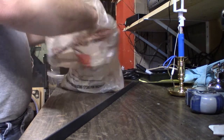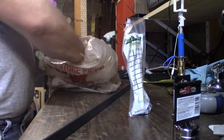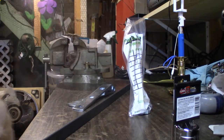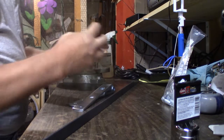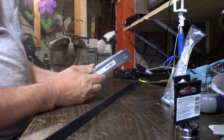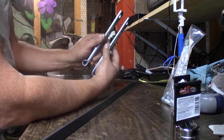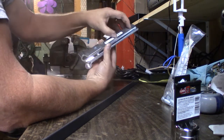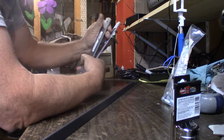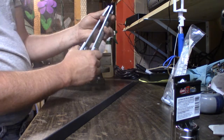Okay. I'm back from Ace, I needed some sockets, but I'm thinking to help get my torsion bar off, I was trying to find some big chunk of metal that had holes in them already. Now, these things go with gates, hinges, I guess, for the gates or something. I thought if I can put bolts through these two holes here, and I can even put one down here and squeeze it tight around that torsion bar, that would give me something down here to hammer on to hopefully knock it out of there.